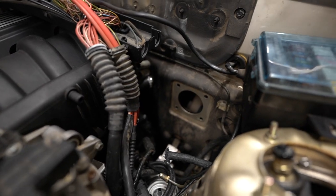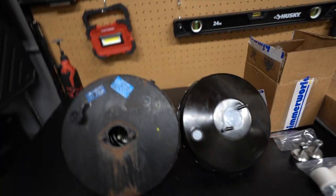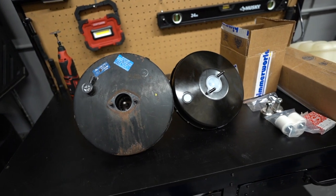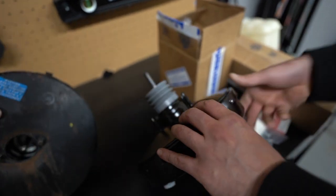We've been trying to see our options for the brake booster, just like we said in the last video. We were possibly going to be deleting it altogether. A lot of people go with the Porsche ATE booster — very similar to the OEM one but it's a lot smaller. Holding it you can't really tell until you put it side by side, but the difference between this brand new ATE booster and the E30 one is massive. On the back you can see how much further inward the new booster is going to be sitting. Unfortunately you do have to modify the Porsche booster. The new ones are about $250 and I ended up getting it for around $320 already cut and modified, just to make that as painless as possible.